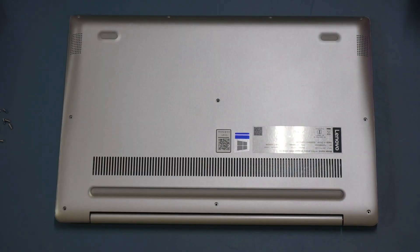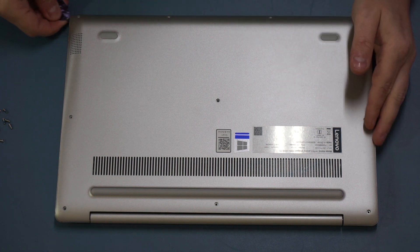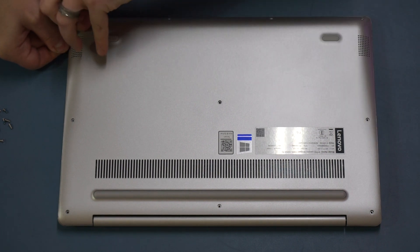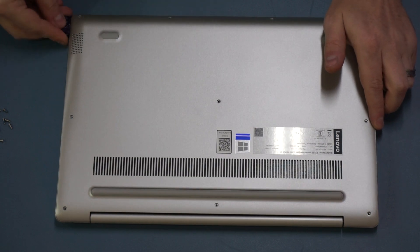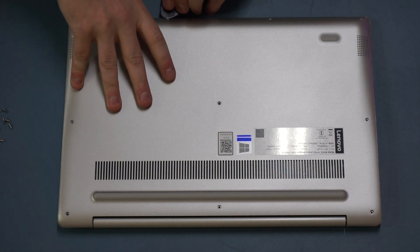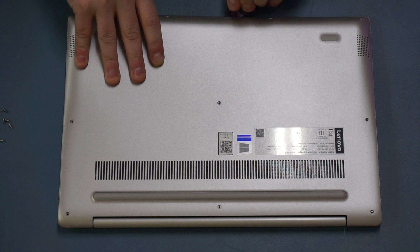With the screws all out, the next step is to use our plastic implement to prise off the plastic connectors that hold this lid on all the way around. Be extremely careful when you do this — it can be very tempting, once you've made some progress releasing a couple of these catches, to just pry the whole thing apart with your bare hands. It's a little bit tricky at first, but once you get going it's not too bad. Just very, very gently start to pry the case open, and when you get resistance from a latch, use your plastic implement to push the latch in and it will release.